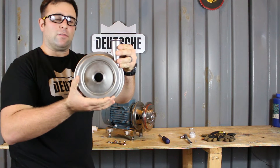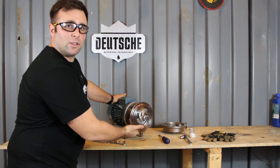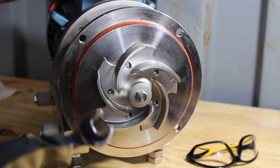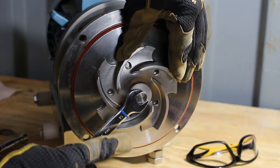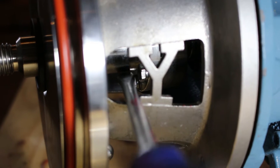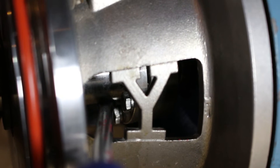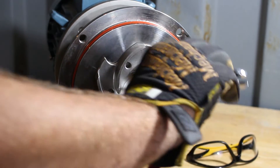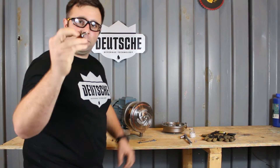As you can see, here's the pump cover housing — that's what the inside looks like. And this is what the inside of the pump looks like. You want to put the 14 millimeter wrench over the nut and turn counterclockwise. If this is stuck, take your screwdriver, put it into the pump by the Y, and lock it underneath the bolts inside of the collar housing — that disables the pump from turning. Put your wrench on the nut and turn to the left. Once you crack it, it should come fairly easily out. This is what the nut looks like.